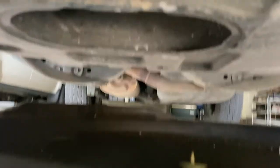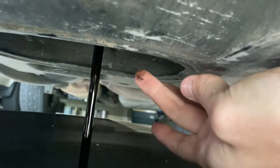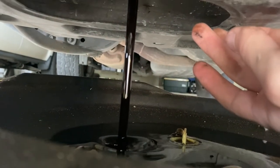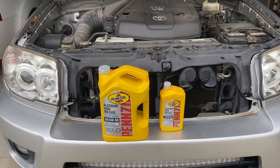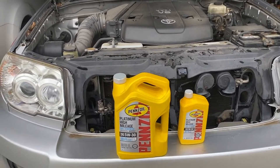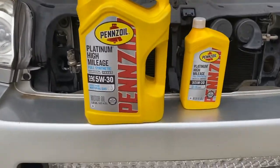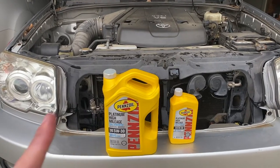I have my oil pan up under where the oil drain plug is and I'm just going to unscrew it and try not to get oil on my hands. It's just draining out — it does take a few minutes to drain so you're going to have to wait. For the amount of oil the 4th gen 4Runner takes, it actually takes five and a half quarts, which is a little bit inconvenient because the normal oil bottle is five quarts, so I had to go get this little one quart bottle. Five and a half quarts is what's coming out, and five and a half quarts is what I'm putting in.